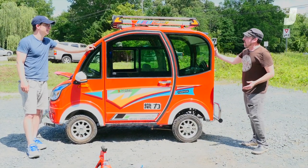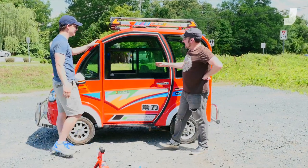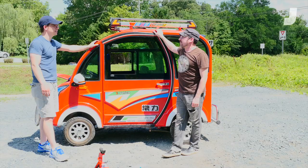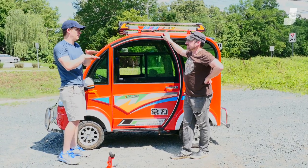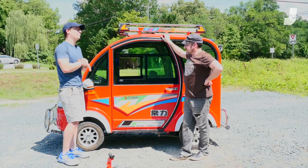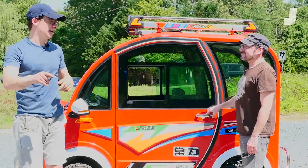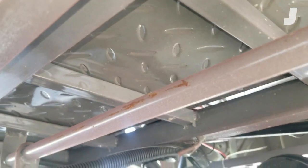Same with the rear glass — it's almost straight but still has a little curve in it. And they've got these nice little frit bands. The sliding window area actually works pretty well. I've been in so much crappier cars than this in so many ways. The thing about the body is there's not a separate frame with any sort of body mounts — it is a unibody, a pretty basic unibody. It's square tubing with the body panels tack-welded to it. I'm going to slide underneath and show what the body looks like, the floors and all that. It's all painted — all this underbody, they didn't have to paint this. This could have been raw steel. There's a little bit of diamond plating, but basically it's just square tubing all around. Nice. It's unibody.